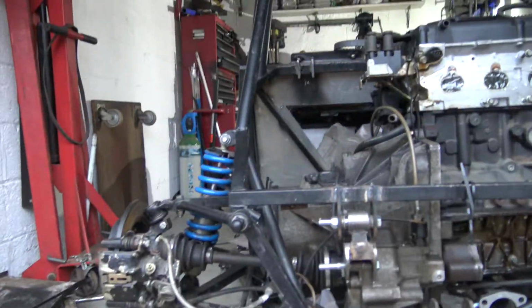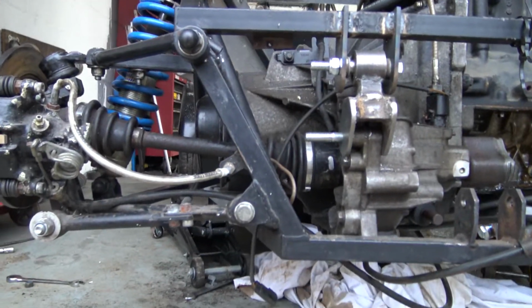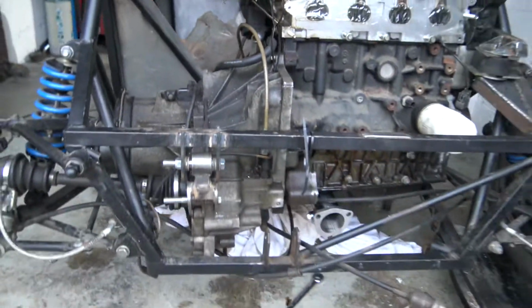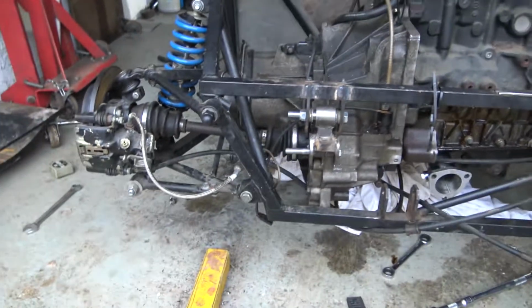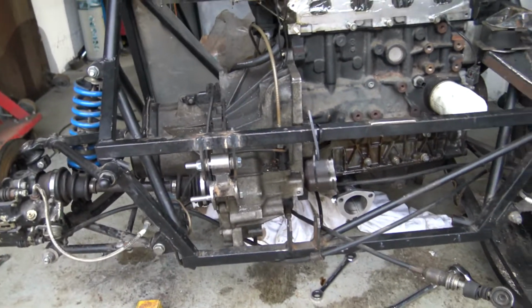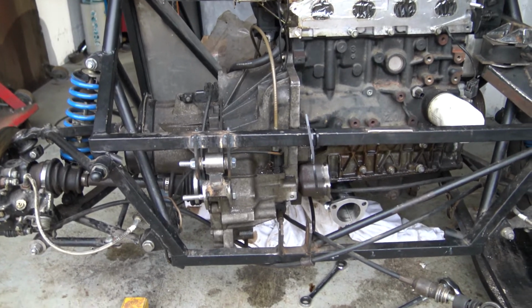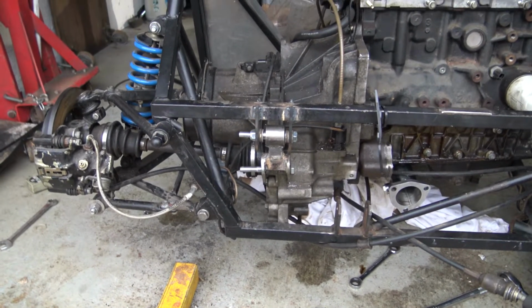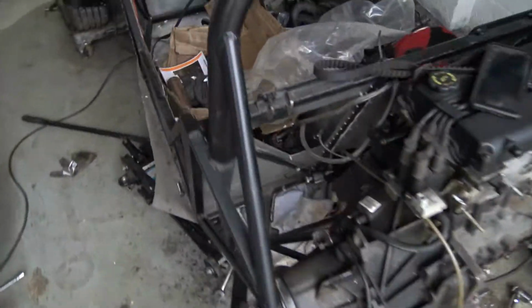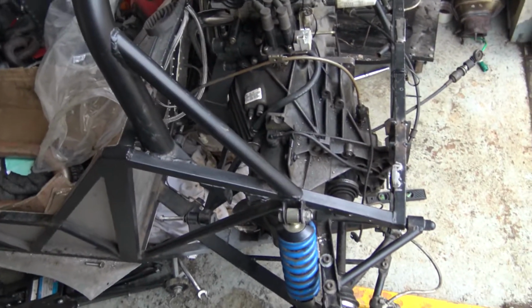And then I thought, oh, it's alright, looking good. And then I got to this level. Oh dear. So my drive shafts are not that great location-wise. The angle's quite a steep one, and that's after I've made it better. I've added some plates to the engine mounts to lift it up. I've messaged a few others that have built these in the past, and they said, yeah, that looks about right, it's what mine were. It doesn't fill me with confidence either, though. So yeah, not sure what to do.